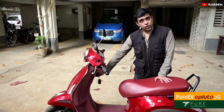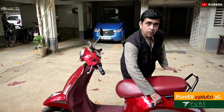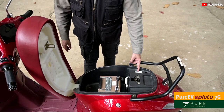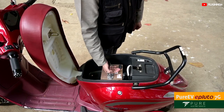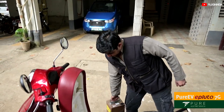This is how. Switch off your vehicle, open the boot, pop and switch off the MCB, unplug the battery, make sure you cover the socket, and the battery just lifts out easily. It's a bit heavy at first go.